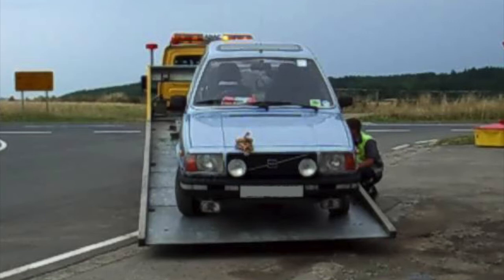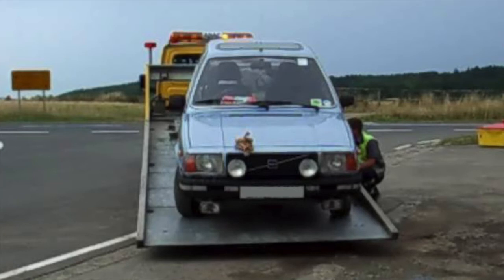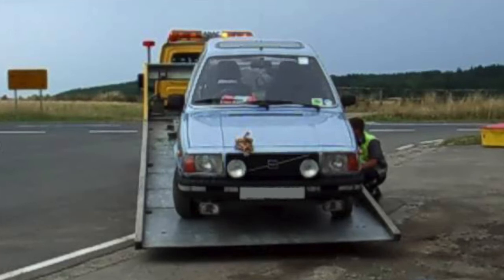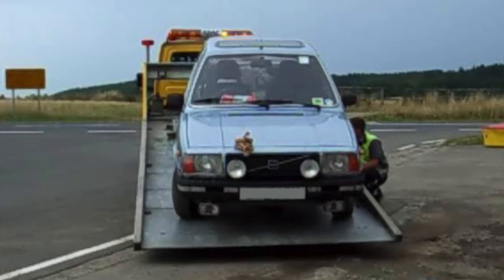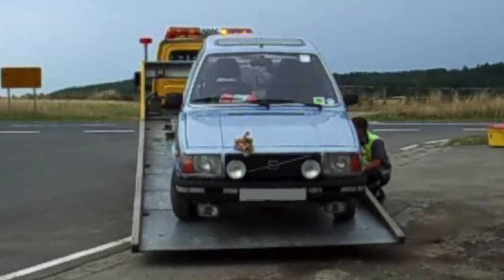The actual problem was that the carburettor was loose. Because it looked fine, I think I probably could have taken it to the garage and they may not have found it — in fact the bolts have probably been coming loose for so long that it's probably been to the garage several times without the problem being noticed. So sometimes you just need to prod your carburettor and see if it's loose.